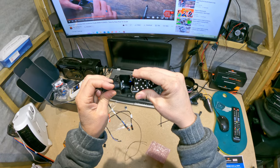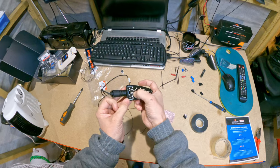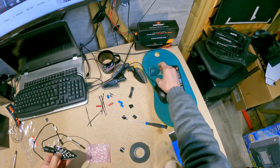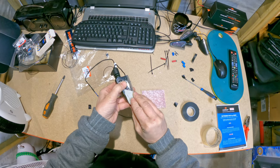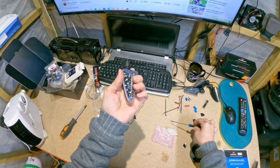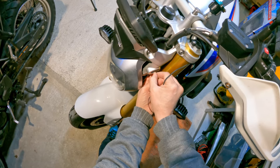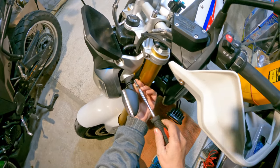As you install this little key into the base of the indicator, the side that says 'bike side' needs to be facing inwards towards the headlamp, essentially at the front of the bike. Get the pointy bit down into the indicator housing - bike side facing in. It clicks when you've pushed it all the way. The common section of the key should be almost flush with the housing. Pull the cables back gently, push the cable back in a little to give some slack. Then get the cover back on. Don't over-tighten this thread - it's only a plastic thread and you don't want to wreck it.